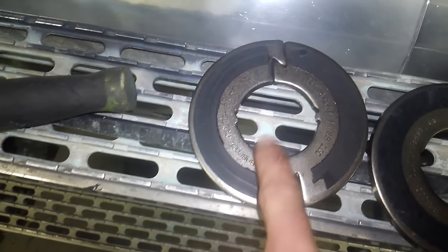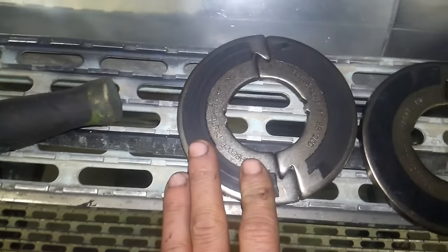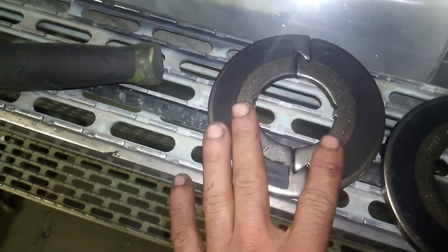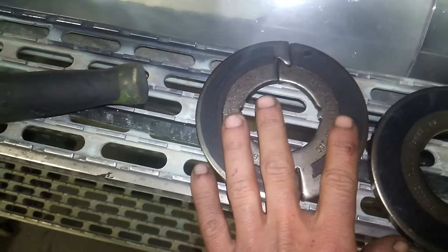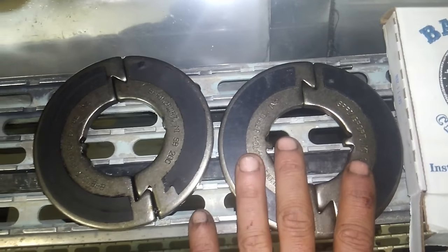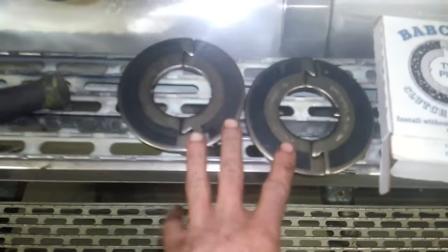Your clutch brake stops working. You can remove the inspection cover and if this clutch brake spins freely without turning the input shaft, this is your problem. I had a lot of grease packed around this — I think I've been over-greasing the bearing and that was part of the reason for this failure. It's also possible I could have the input shaft seal leaking on the transmission, but it appeared to be mostly just grease. I cleaned it up and I'm going to install this new clutch brake, and next service make sure it hasn't packed full of grease again.